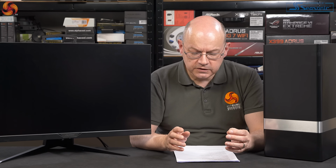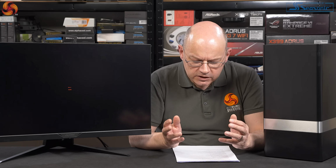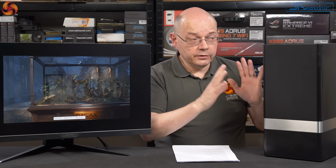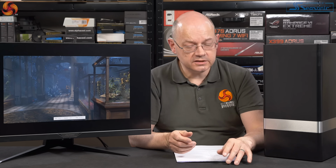So it does make a difference. However, the parts were nowhere near throttling, so that is actually really rather impressive. Under heavy load, the CPU, which has a TDP of 75 watts, draws very slightly over 75 watts. The GPU draws 190. Put those two together, and the system is drawing about 250 watts in most mixed loads, such as 3D Mark. So the heatsink, the cooling system inside this MonsterLabo The First, is working for its living. I mean, 250 watts is not to be sneezed at, and it pulls through.